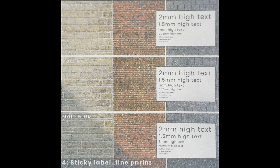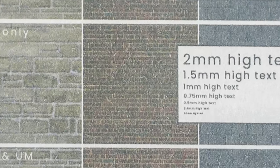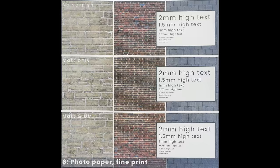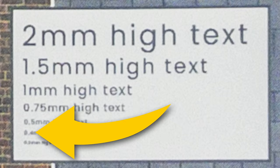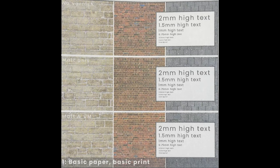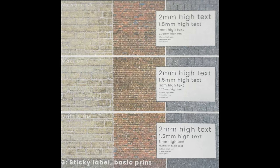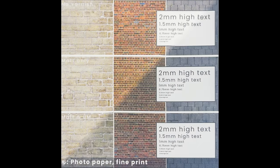The labels are basic, and you can tell — the definition between the bricks is not as good as on the basic paper, and it's definitely more grainy and fluffy around the edges. Here's the photo paper: basic settings are bright and well defined, although the brick looks nothing like the dark brown it was on the computer screen. With the fine settings though, it really comes to life — colour matches the screen and every single brick is well defined. The mortar, just seven hundredths of a millimetre thick, is clear as a bell. The half-millimetre tall text is readable and the 0.4mm number below it is legible. At a normal viewing distance all three perform well; it's only up close that you see the obvious benefit of the photo paper.